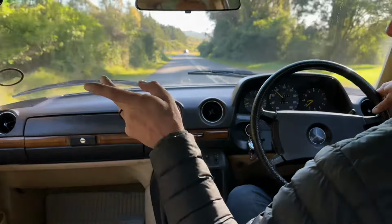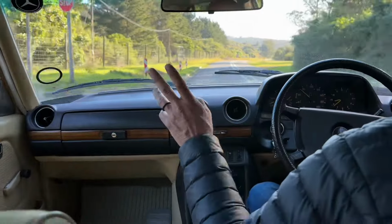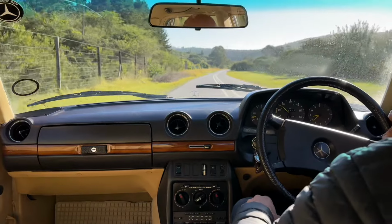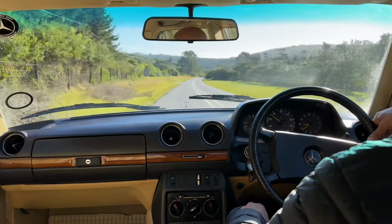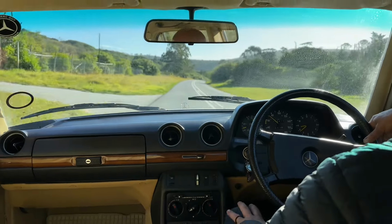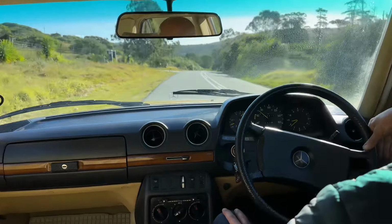As I said, I replaced that door there when it went in for the respray, and I hear a slight wind whistle there, so I'm just going to ask the guy to adjust that. See, there's a tiny little bit, about a 2mm gap on top, so I'm going to adjust that out. But other than that, what a beautiful job was done on this car.